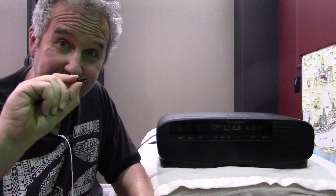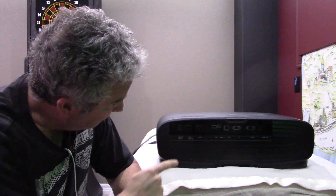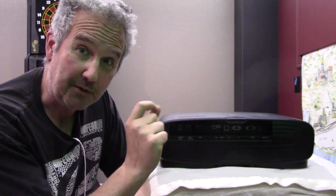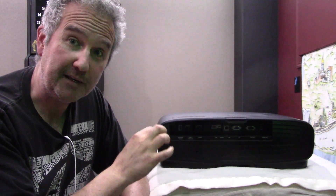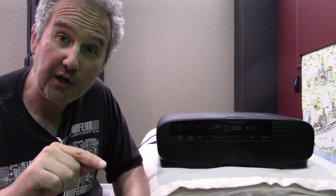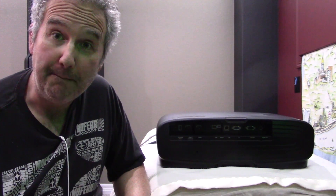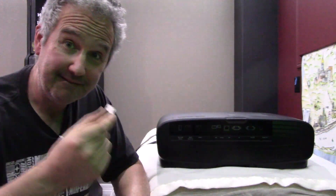You need one of these USB flash drives. Back here there are two USB ports — one says service and it's a micro USB type, kind of like the one you find on a Samsung phone. That's not the one we're going to use. We're going to plug into the standard USB 2.0 type jack here on the back. So what you do first is go to the Epson website, look for your model, and download a BAT file — a dot-bat file — directly onto your flash drive.